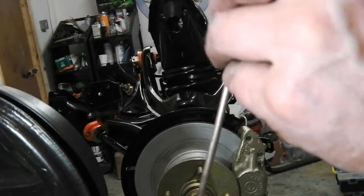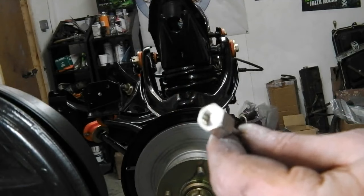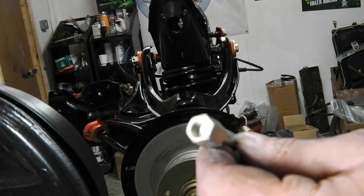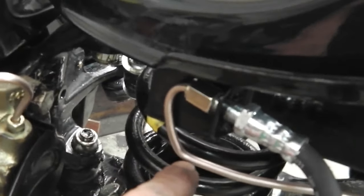You can bend that now and it won't internally crush because the salt doesn't compress. Learned that off YouTube. That's what YouTube's handy for. Okay, let's bend that to shape and I'll take you in on the camera. So to show you, with the salt we were able to get quite a good tight bend, no collapsing. Cross, then up into the divider, then over we go and down, across we go and round, up, over and round the back of there to the next flexi hose.